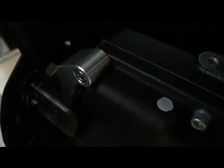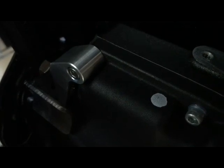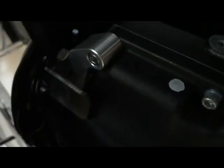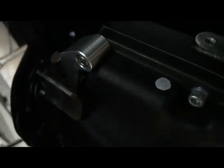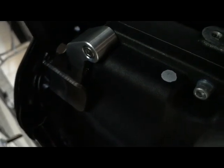So this is the crossover, just starting its travel underneath the bike, and this bracket here is attached to the new billet piece that they give you. That's the left side most rear, and then the one just in front of it on the left side of the bike, the oil pan screws. They're longer. Little blue Loctite and 110 inch-pounds. And now we got to test fit the crossover and start assembling the pipes.